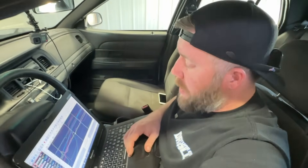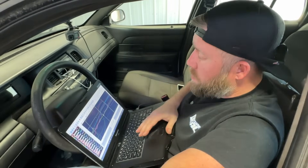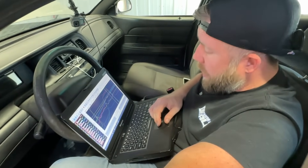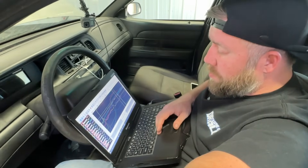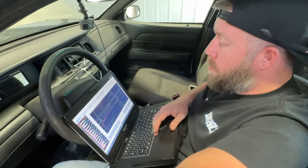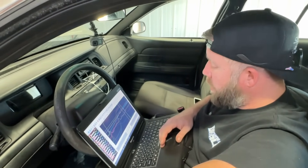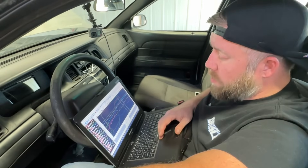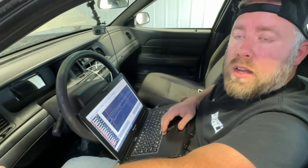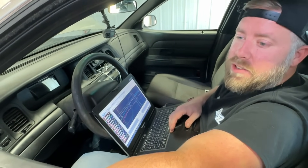After that pull we're running out of boost control. The setup was targeting 25-25.5 pounds but it just wouldn't get there. We're sitting at 90 percent duty cycle on the PWM scale, which is pretty much pinned. Going ahead and putting it to 100 percent, though we may actually need more wastegate spring if we want more boost. Everything else is looking good — manifold air temp looks good, timing looks good. We're at 14 degrees on this motor and according to the plug we could still put more in there, but there's no sense in leaning on this car just to get a dyno number on a low-reading dyno.